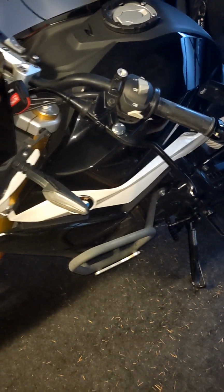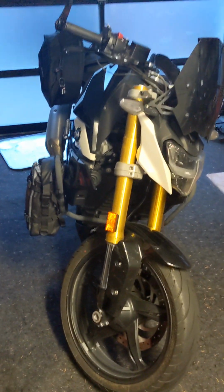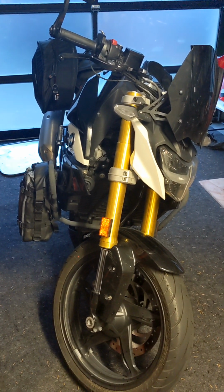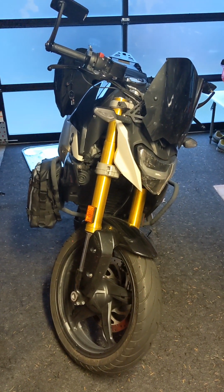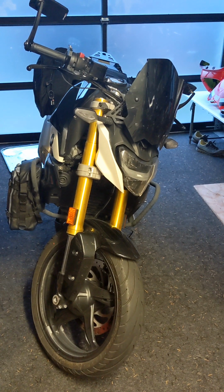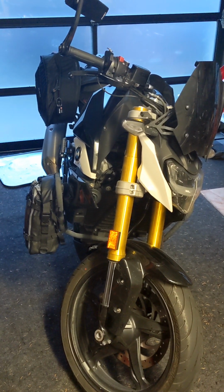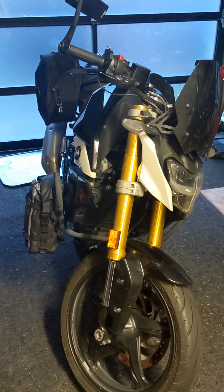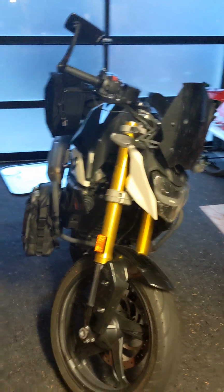But everything we just ran through, this might sound like overkill to some of you, but I do what I just did every 3,100 miles. The chain maintenance I do more frequently than that. The chain clean and tension check is every 400 to 500 miles. But I get an oil change and a full service in every 3,100. Might sound like overkill to a lot of people, but this bike's got 19,000 miles on it and runs like the day I bought it, and I hope to continue that trend for many, many more years. So that's what I do.